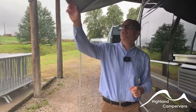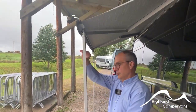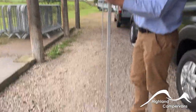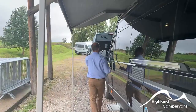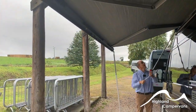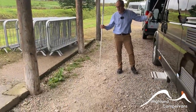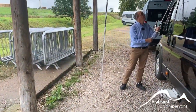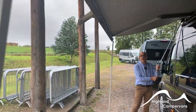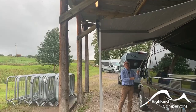It's the same for the other side — push in, release your lever and lock off, and then continue winding the awning out and walking the legs out at the same time. Maximum extension on these is about two and a half meters and they are sun shades, not storm shelters, so in wet or windy conditions you do need to put them away.